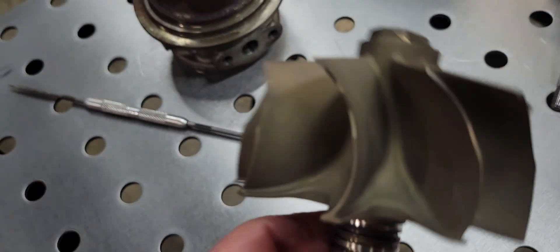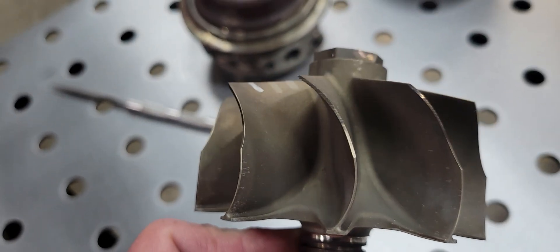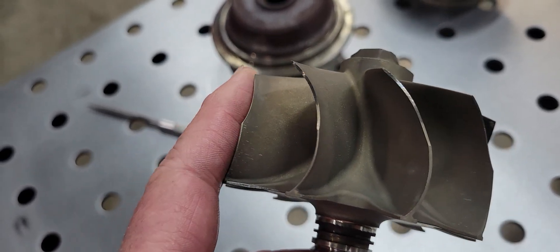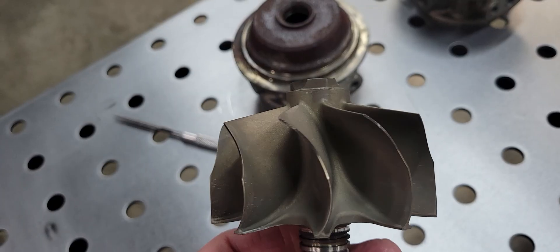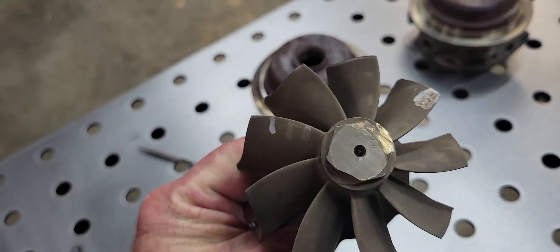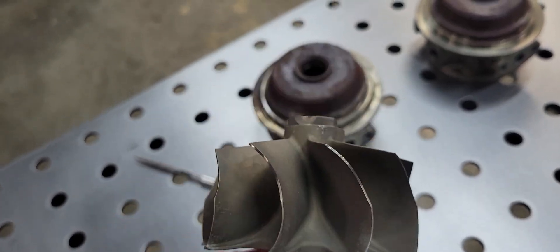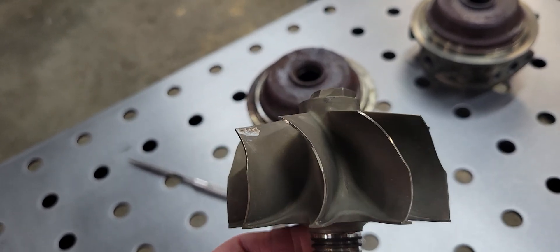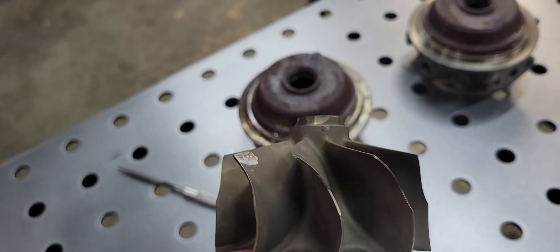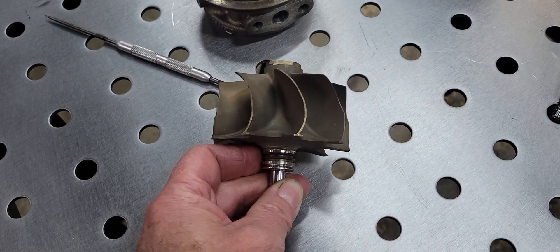These parts are available from Garrett — they are expensive and sometimes hard to get — but this is an avoidable condition. When you put your turbo together, make sure that that flange and that clamp are perfectly aligned and tightened. I've got a link that will pop up at the end of this video that will show you exactly what we're talking about with the turbo in hand.